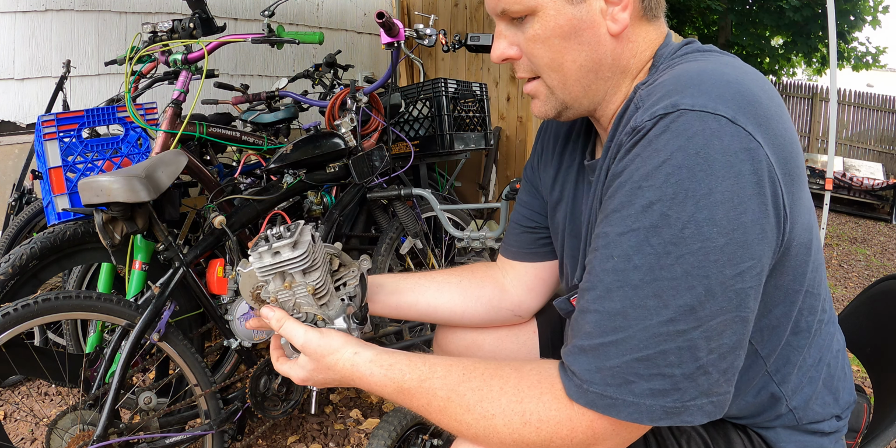Even in a car, you'll see smoke when it's idling and running, a little bit of blue smoke. Blue smoke means oil, burning oil. White smoke is water, usually in a four-stroke. If you see it smoking, it's because of the valve seals. Now, it could be because the rings wore out, scoring in the cylinder, blah, blah, blah. Usually the reason is the valve seals. They wear out because they get overheated from not having proper oiling. Now, this has a lot of little cool oiling passages.